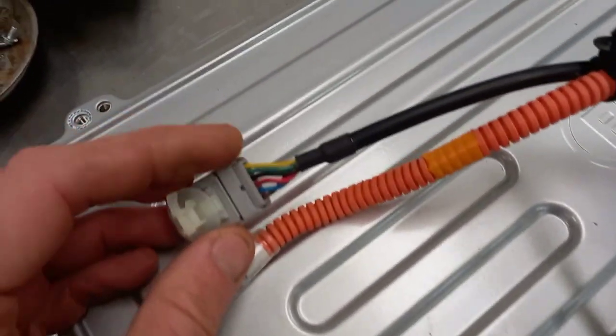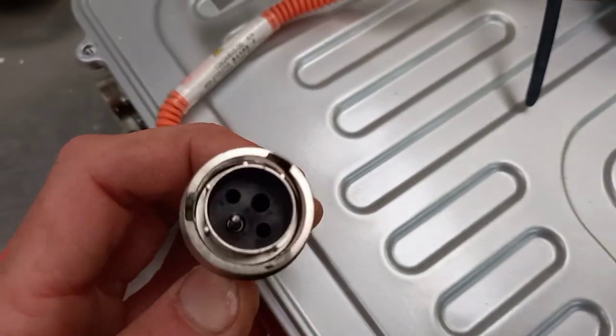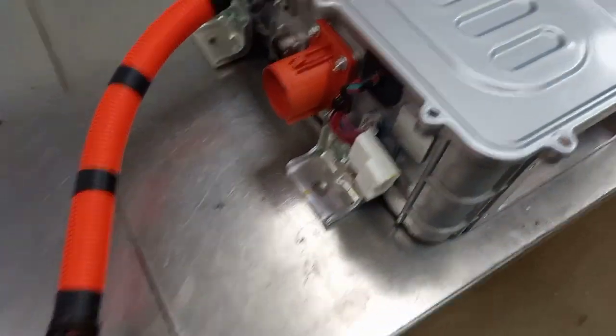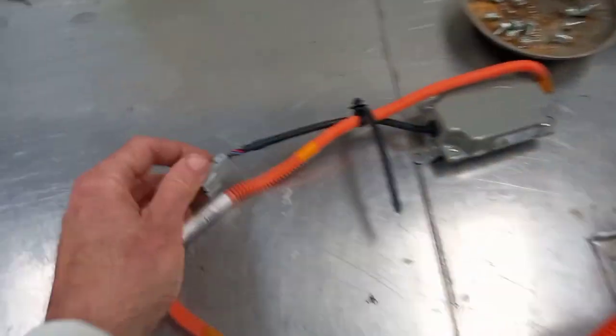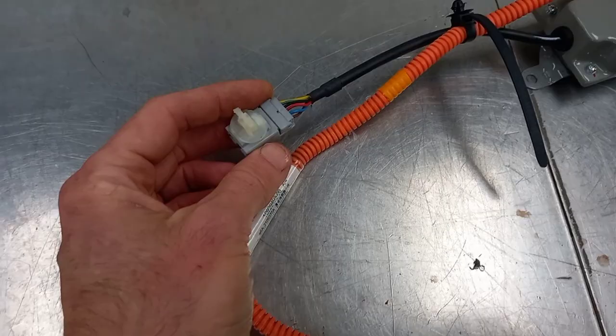It will connect to the negative and the chassis on the 12 volt with one of these pins, and the negative of the big battery with that single pin in this very fancy connector — one of many very fancy connectors — and it will measure the resistance and then start squealing, or at least tell the dashboard or the computer to start squealing, if it finds any kind of connection.